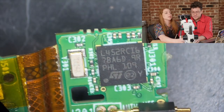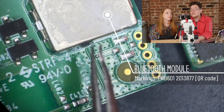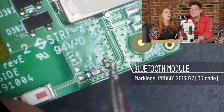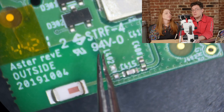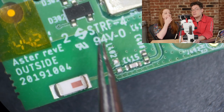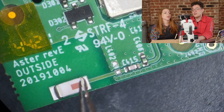There's also a can over here, which is almost definitely the wireless device — not only because of the can, but because of the antenna. You can follow it over to a little impedance matching network and then a chip antenna. It's complicated to get wireless devices certified, so one solution is to use a pre-designed module for the wireless, do all the electromagnetic certification, and sell it as its own module. You put that onto the board you're designing and have fewer things to deal with. The ground plane around the chip antenna is absent to give it room so the fields coming out of it aren't absorbed.